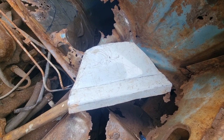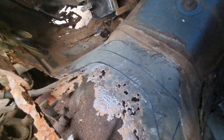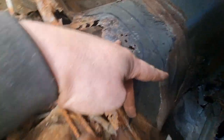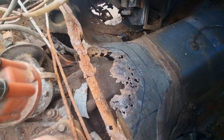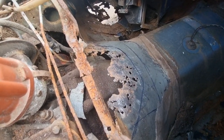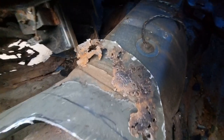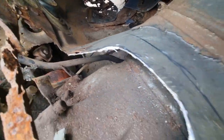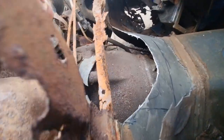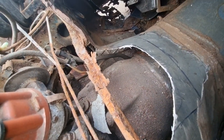Just a little update - I've started fabricating the metal for the bulkhead. I'm gonna cut all around there, up to there, and get that piece of old metal out and it'll give me a new lip. I've now cut all that out - there it is. That manky piece of metal is off. I've cut all that out in the gearbox tunnel and I'm just about to test fit it.